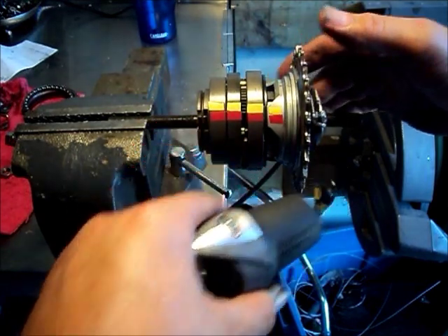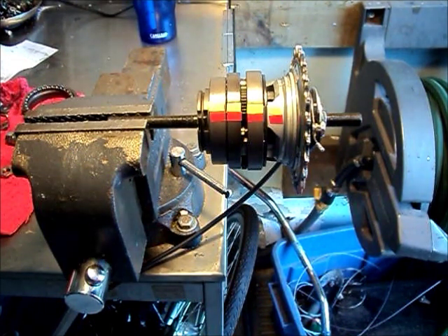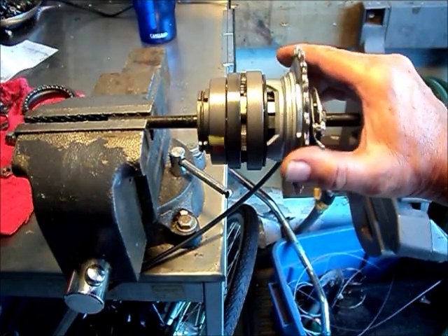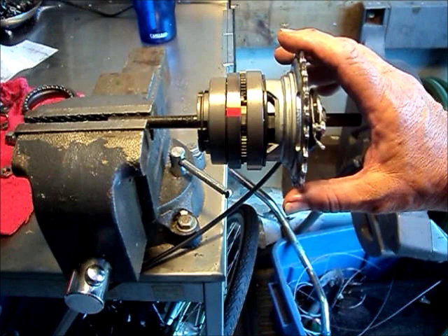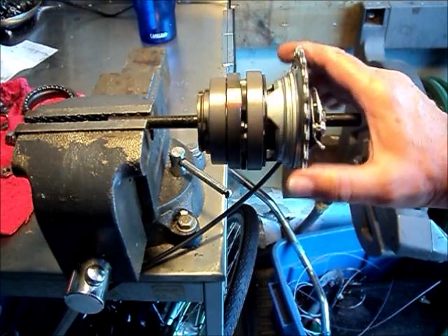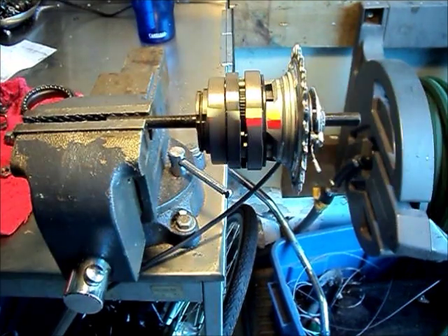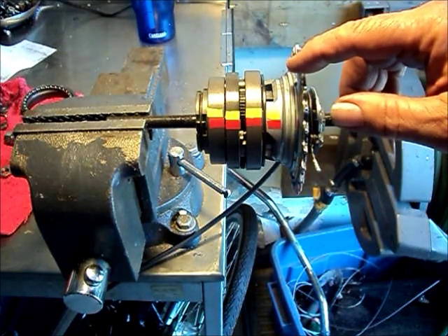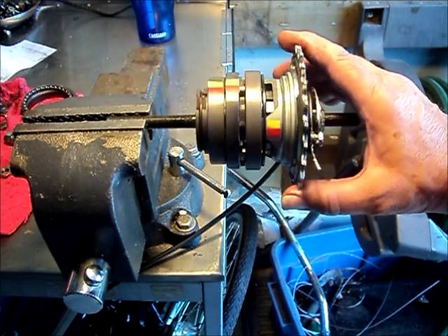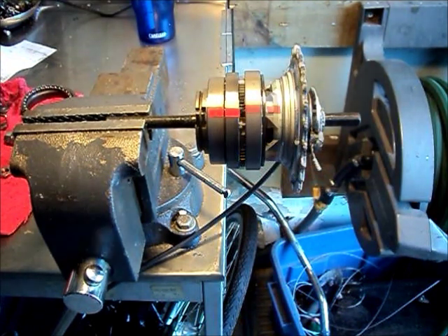When we get to fifth gear, we start engaging them in combination. In fifth gear we have second and third stages with the sun gears engaged to the axle. You'll see third stage outrunning second stage and the final drive outrunning third stage, with the input driver and stage two turning together. Final drive output one to one point nine two. Sixth gear engages the first and second stages — third stage and the final drive stay in lockstep, third stage outruns second stage, second stage outruns the driver. Final output ratio one to two point two.